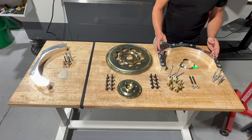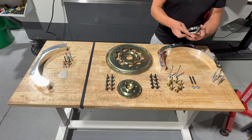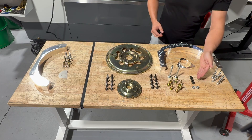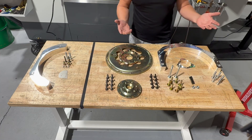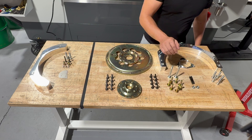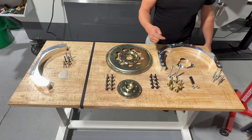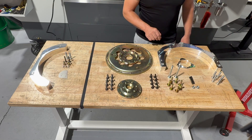This is our base kit. After this we go to the starter spacer — pretty simple, it has a concentric ring to keep everything nice and concentric. We even machine special studs that allow your starter nuts to bolt on clean. These are your bell housing bolts — you get most of them along with two longer bolts, because two of the bell housing bolts go through the dowels, through the bell housing, through your adapter plate, and actually bolt into the block.